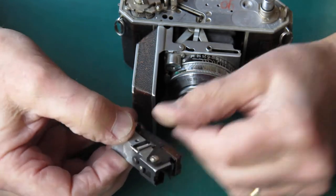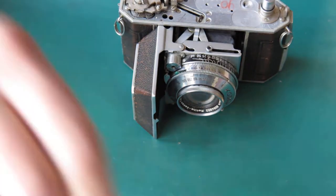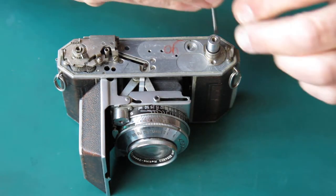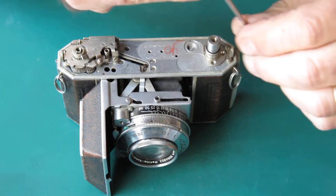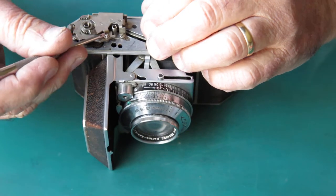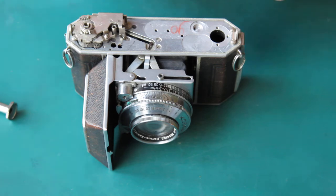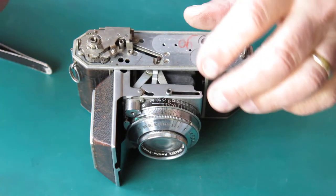We'll just have a quick look at this rangefinder. You know, it's very sticky, it doesn't return to the rest position. But optically it's not bad, you can actually see through it. Let's have the rewind off. And hook that spring. The springs I don't put through the ultrasonic cleaner, there's no point, and they're only likely to get lost or damaged.